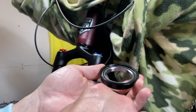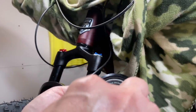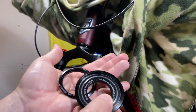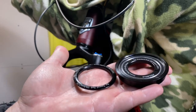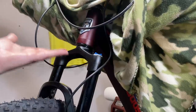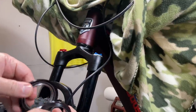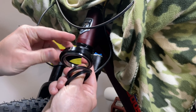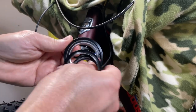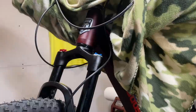Just for clarification: if using a standard fork — a straight steerer fork — I would have this crown race onto the fork and that just goes right in there, and it's in place. Everything clarified there. But this headset works for either. That's great news. It also helps clarify and understand that this, in this Ardor X1, is a standard headset. I'll zoom in here. I've got this one a little loose just so you can see this bearing — you're going to be able to see this bearing out just a little bit. That's the bearing seated up into this lower headset cup, and the crown race on the fork, up in the head tube — this tapered head tube. There you go.